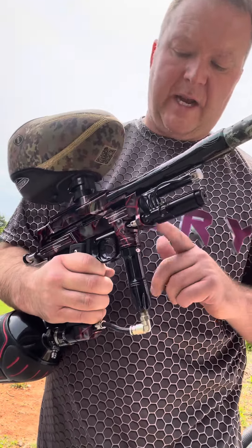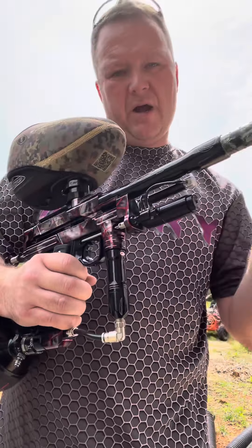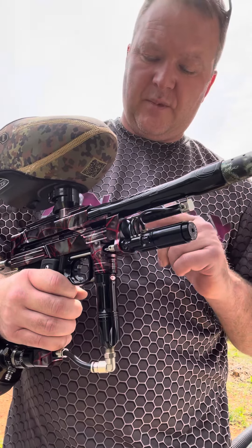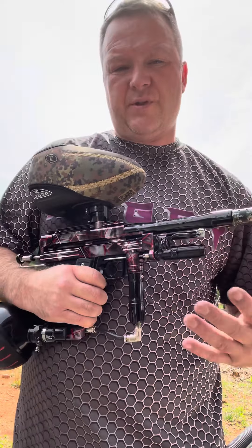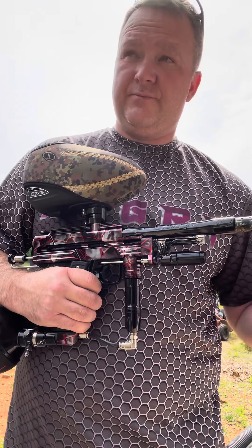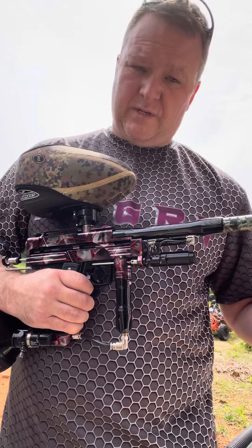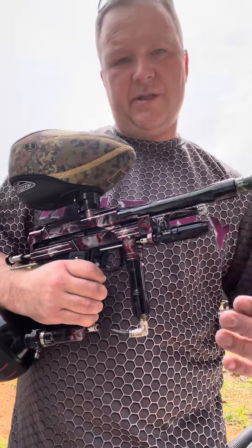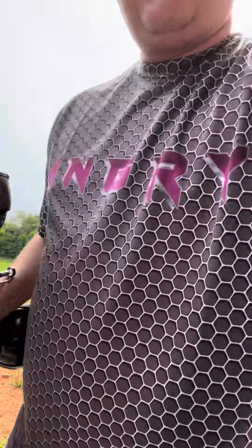When I got her put back together, we're leaking out the VASA. This is a pre-2K VASA, so it doesn't have the rounded quarter-inch rounded edges. I knew we were going to have problems with this because I've encountered it in the past where somebody wanted to run a '99 VASA on a 2K body — it just doesn't work most of the time. We kept pushing the O-ring out around the edges, so all I did to remedy this was double up the O-ring.